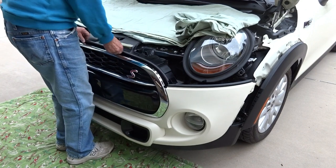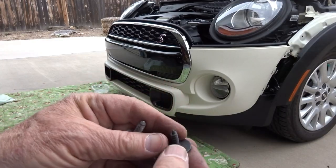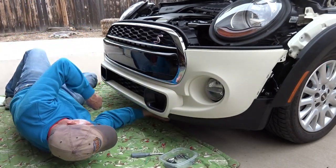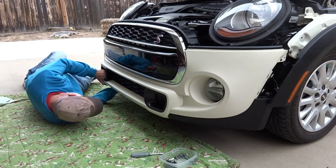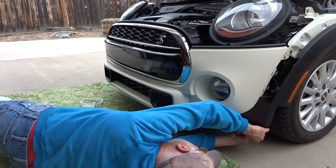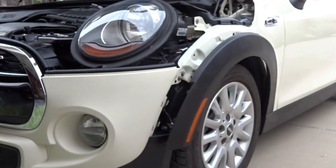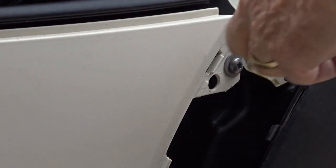I'm putting the front clip back on the car. The limited instructions from MINI recommend having somebody help you put it on, but if you're just real careful, you can get it on yourself. There are two different types of attach bolts: the torx head, and the small 8mm self-tapping screws that go into little metal clips and plastic pieces underneath the car. Work with those, get everything lined up properly, and make sure the metal clips are still on the receiving end of where those bolts go. You'll be on your back for half an hour or so putting all those clips together. Then there's the last bolt up on the upper corner of the front clip — get that one lined in, tighten it up, and if everything else looks good, go around, check it, and you're done.